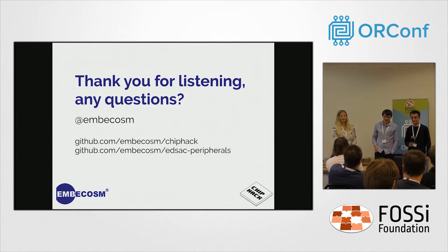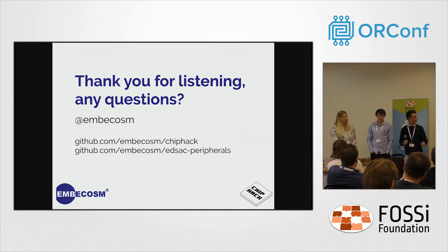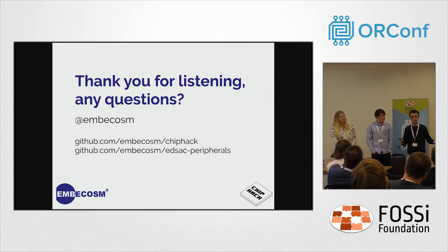Q: How many peripherals were there on the original EDSAC? A: There were even more — as mentioned, there were CRTs displaying what was in memory. EDSAC evolved over a long period, so early on there was just initial orders loading, a tape reader, and a teleprinter. It later gained things like a telephone dial for number input. We were aiming to replicate an early EDSAC, which made things simpler, but there's plenty more you could make yourself.